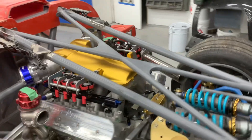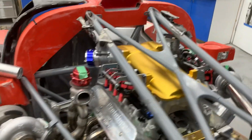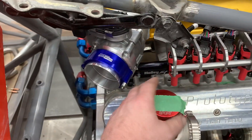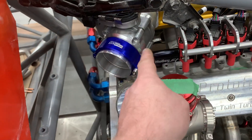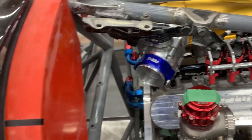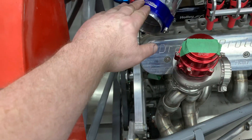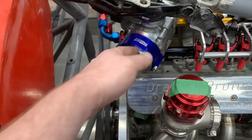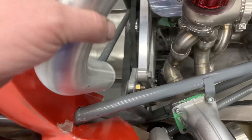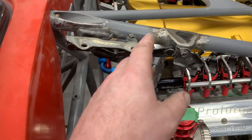Finished the two angled pieces for the throttle bodies to basically turn the throttle bodies and give them more of a gap to the wastegate. If I kept them straight and then put the bend in after the throttle bodies, bolted the throttle bodies flat to that, the bend would have come a lot closer. So I had the idea to machine some angle plates to bolt there and to the throttle bodies - they're all o-ringed. I drew up a quick CAD sim to confirm what angle I needed to get to my vertical pipe, and found I needed about a 28-degree angle.